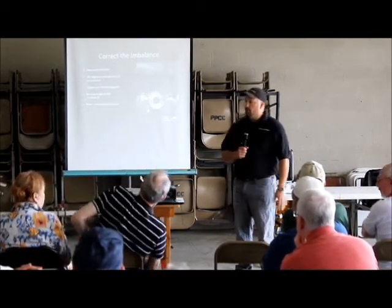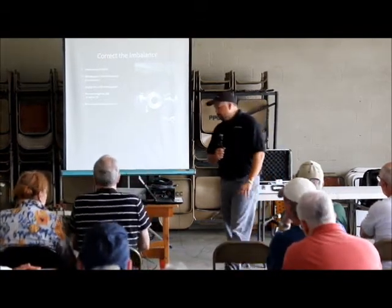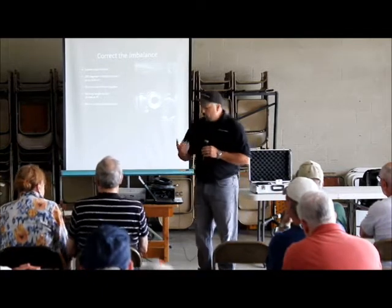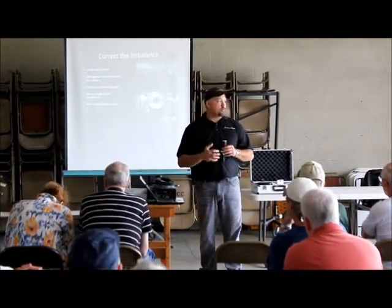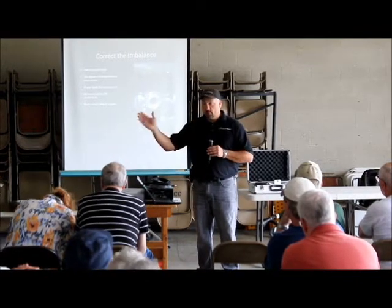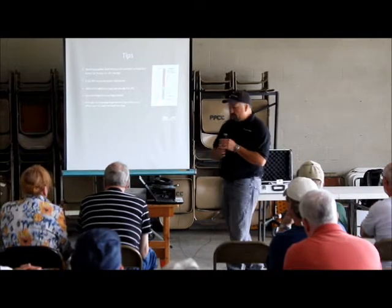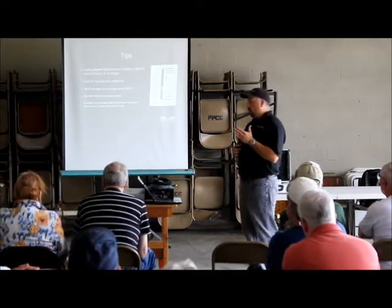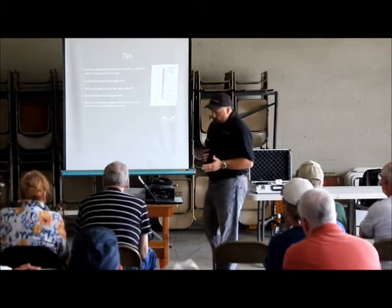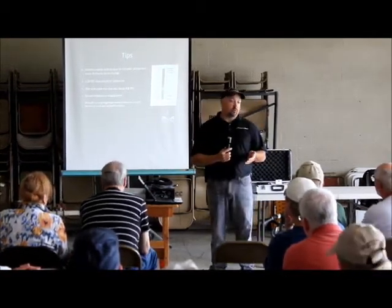There's a learning curve just getting everything mounted. The manual goes into more detail about how to tape the cables and make sure the cables aren't clamped — there is a process to go through. One of the things I always do is on a wooden propeller: you should be re-torquing every 25 hours or with every little change.